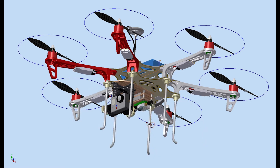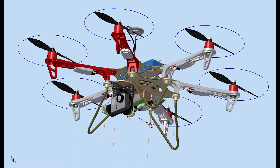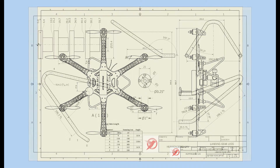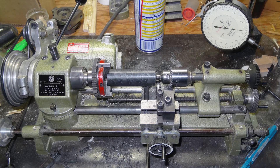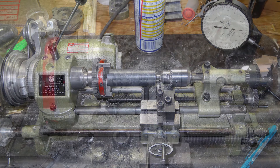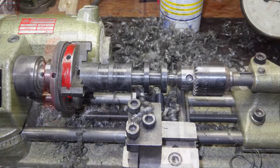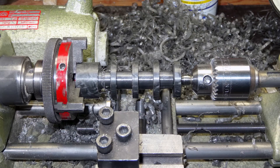I mocked up a few new leg designs in my CAD software and decided to build version 3. The leg anchor points are machined out of 1-inch nylon round bar — these could be easily made with a 3D printer. The six anchor bolts to the same place on the F-550 that the factory legs do.